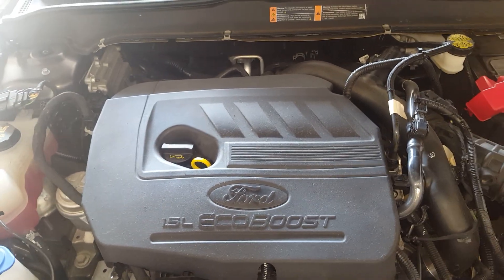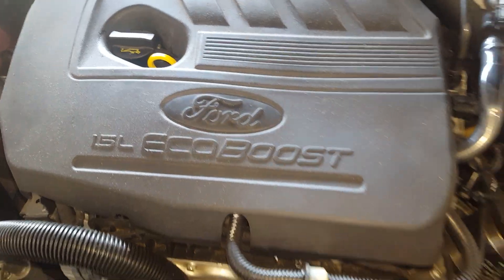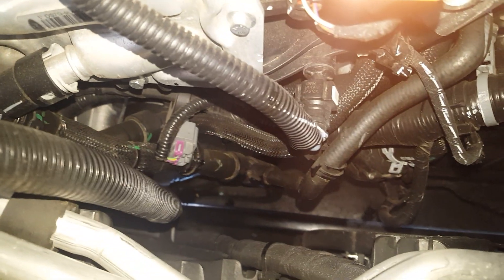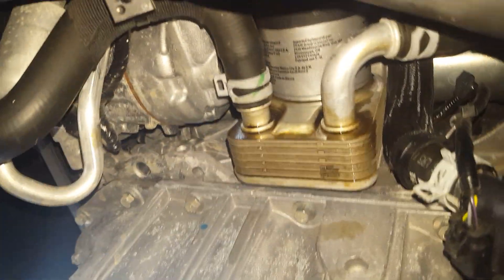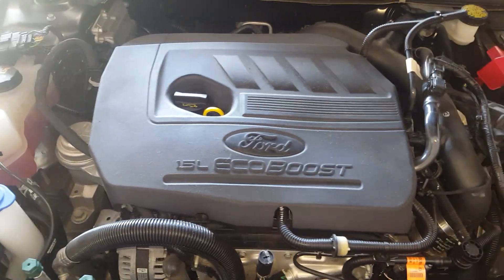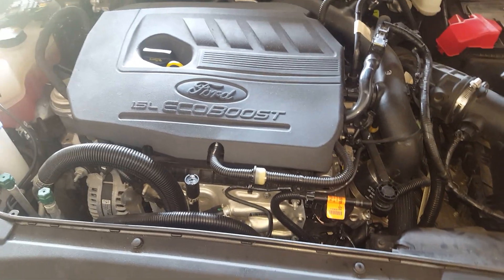After you do your oil change, maybe a couple days after, check the oil level and make sure it didn't drop. I've already checked the oil again — it's good. My car may smoke a little bit since I spilled some oil on the frame near the exhaust — that's normal, it's just burning off the oil. There's a little wet spot underneath but that's just oil dripping off the hoses, which is normal, so wipe that off. Check it every day or so just to make sure you're not losing oil. Also, since this is a Ford Fusion it has an oil reminder — I'll have a video on how to reset that. Thanks for watching.